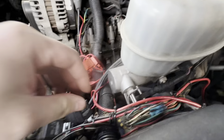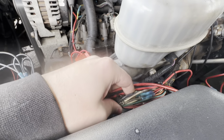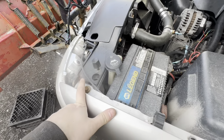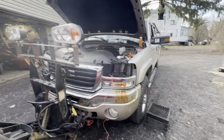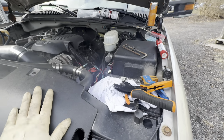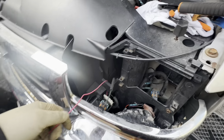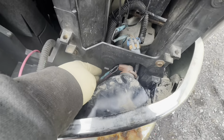And then them two wires that aren't being used or don't have power going through them for the turn signals, they're probably right here. And I could probably just shove them to the turn signals. Okay, so that works. I just ran a wire up from down there. The color's changed up here somehow. Don't know why. This harness is hacked, but it works. This one is gonna be for that side. So I need to run it across. I'll pull this top tray out down to the turn signal and just tap into the wire.